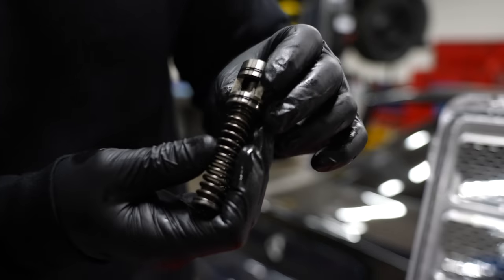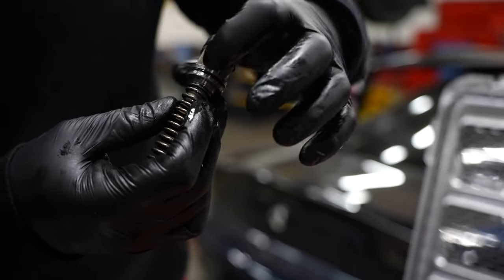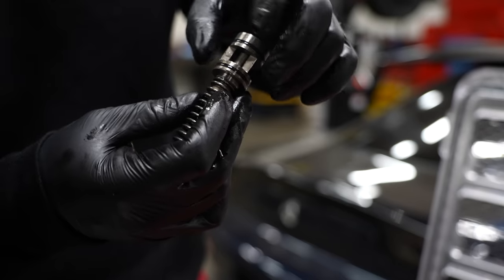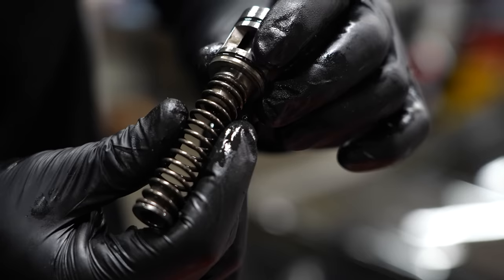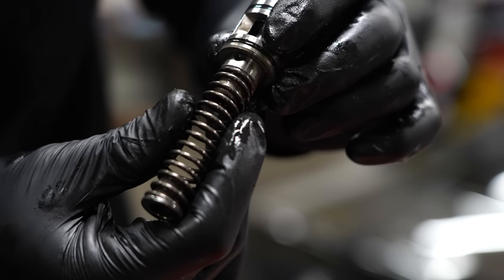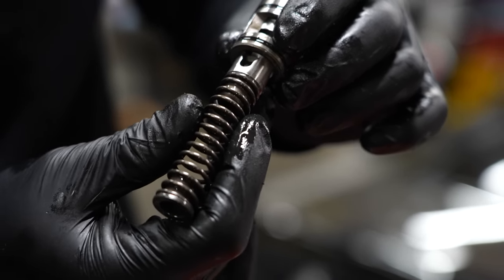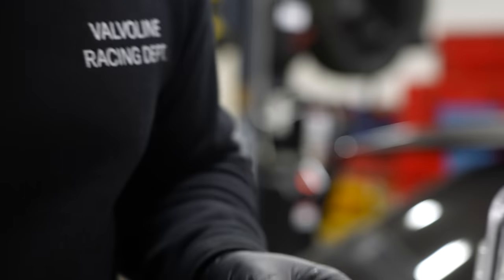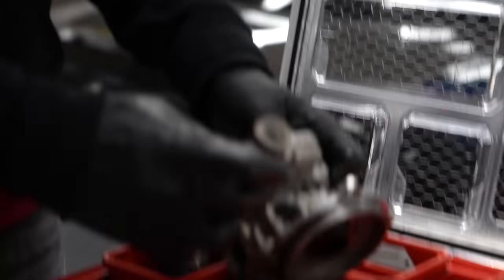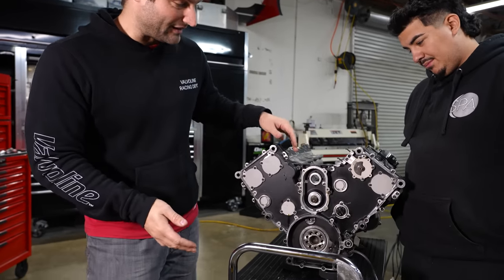It took a little bit to figure this out, but the pressure put onto this piston draws the piston down. All the pressurized oil is going into these three veins here, but that's just for structural rigidity. You start out and it starts to bleed a little bit — bleeds more and more and then it opens up. It kind of accelerates how much based on the spring pressure. That shape is very specific to this motor or whatever their intentions were with oil pressure.